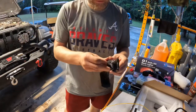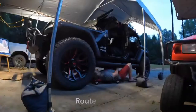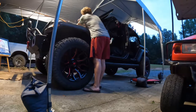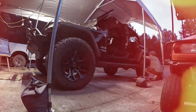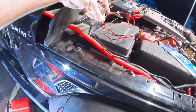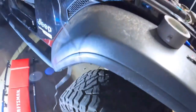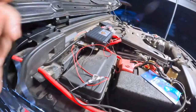All right, good rock lights, let's unravel them. In order to feed the wires, I've got this white wire right here — shoved it down the side of the battery, running it down the bottom of the Jeep. Take the end of this to the white wire and pull it up alongside, coming over here behind the power distribution panel, then run it over there — that's what we're doing.